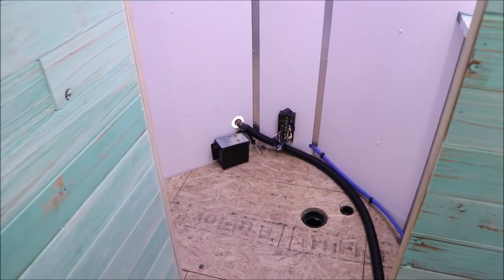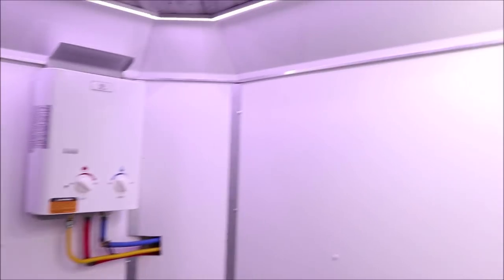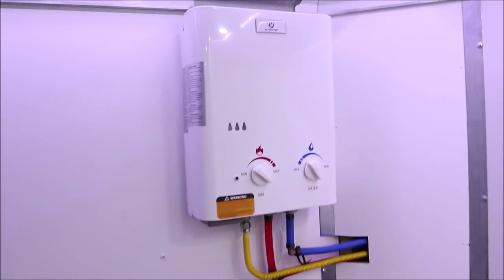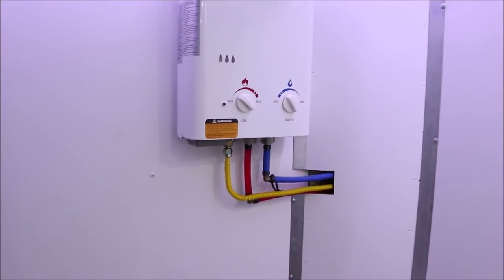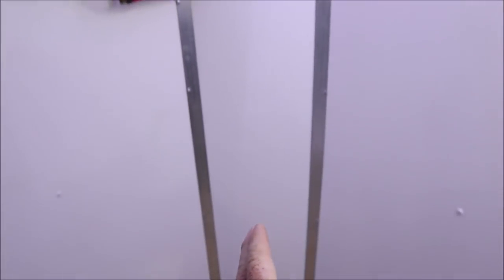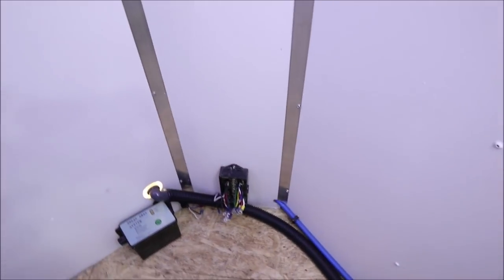I want to start first with our bathroom. It's finally trimmed out — it's got all the corner roof trimming done. This panel has been off the whole time; finally got that put up. The water heater is totally plumbed in: cold water going in, hot water coming out, LP gas hooked up. Everything just runs right down this channel there in the nose cone, and the LP gas runs right down off the floor and right to the tank.